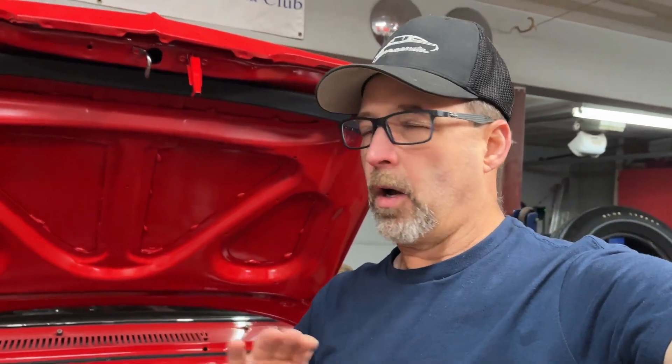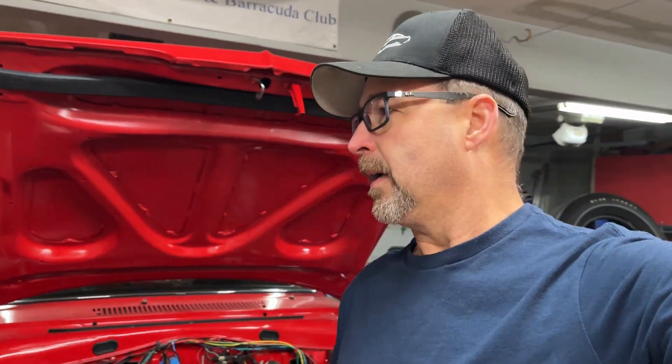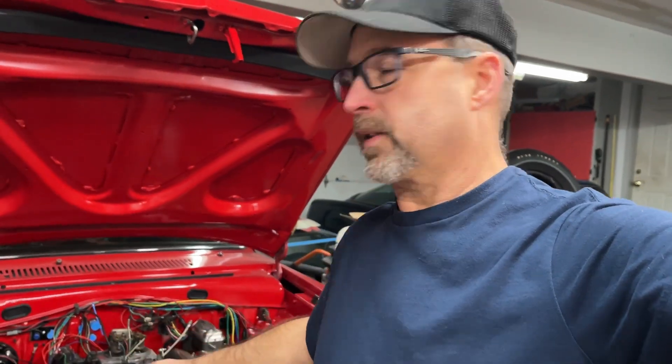That's kind of it — I know it was a very high level overview. There's a lot of details I could get into, and a lot of things you can add on to this. You can put knock sensors connected to the computer, vehicle speed sensors, air conditioning triggers so it knows to keep the idle up just a little bit when the AC is on and you're at a stop. All that stuff is available if you want to put it on the car. And you'll have to make an adapter for the throttle body to go onto the intake manifold of your choice — pretty straightforward, not that hard, kits are available.